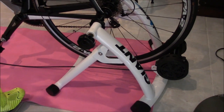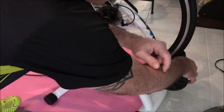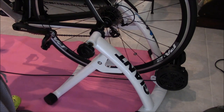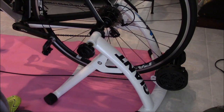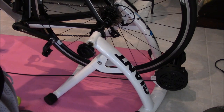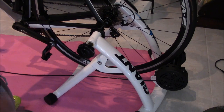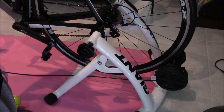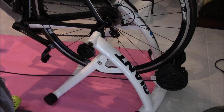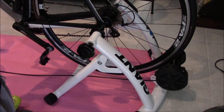Back here on the back you have the magnetic roller. Notice the wheel is slightly off the magnetic roller right now — I want it to free-spin separately from the magnet when I'm not riding. The reason is that if you leave your bike sitting on the mag trainer with the wheel up against the magnetic or fluid roller all the time, you'll get a flat spot on your tire. Just like a car sitting in one spot for months develops a flat spot on the rubber, the same thing happens with bike tires — and with higher-end racing tires, this can actually damage them.